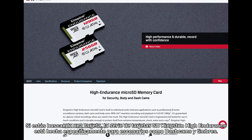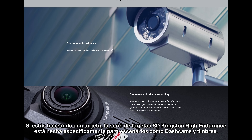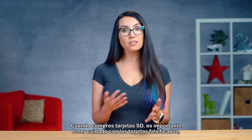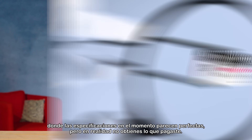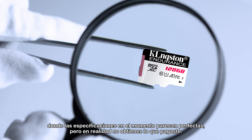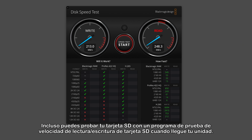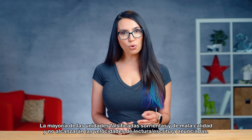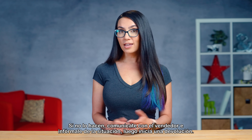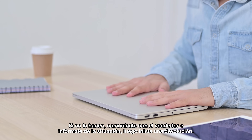If you're looking for a card, the Kingston High Endurance series of SD cards are made specifically for scenarios such as dashcams and doorbells. When shopping for SD cards, it's important to be wary of counterfeit cards where the specs on the site all look perfect but in actuality you aren't getting what you paid for. Read reviews to check their performance against their claims. You can even test your SD card with an SD card read-write speed test program when your drive arrives — most counterfeit drives are slow and poor quality and won't meet the advertised read-write speeds. If they don't, contact the seller and advise them of the situation, then initiate a return.